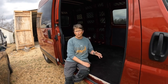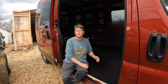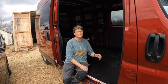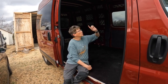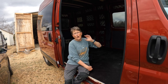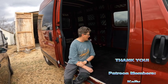This belongs to Becoming Bed, and we're doing a full build out on this one as well. We've got the floor ripped out, the furring strips down, the insulation down, and the floor put back in. The Havelock wool is in the ribs, along with the nailers for the ceiling. Also, all the kill mat is up, so just kind of squeeze and work in on this one when I am busy doing something else on the transits.